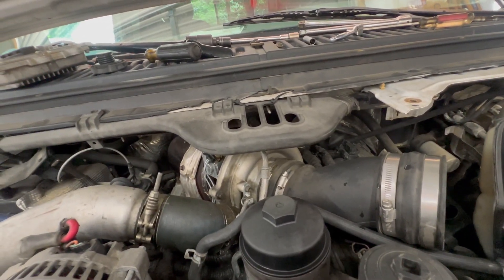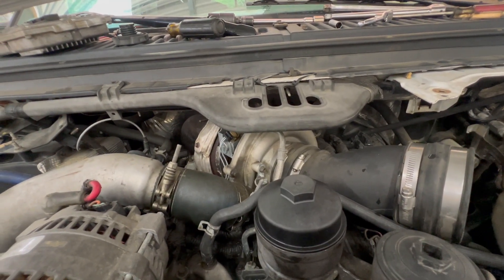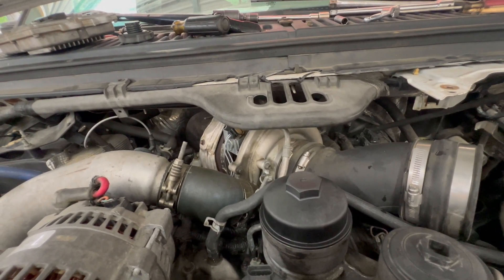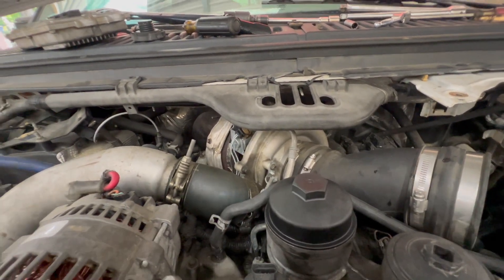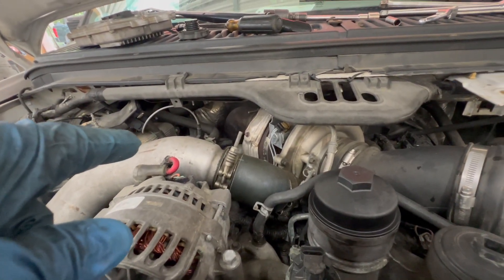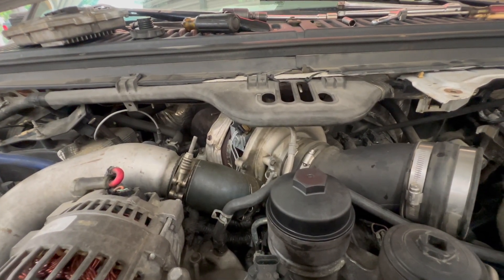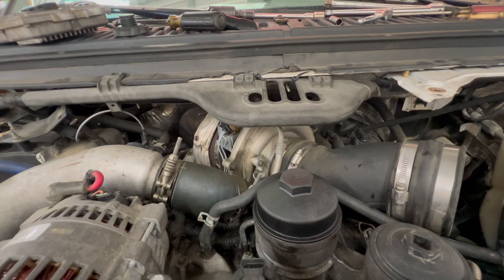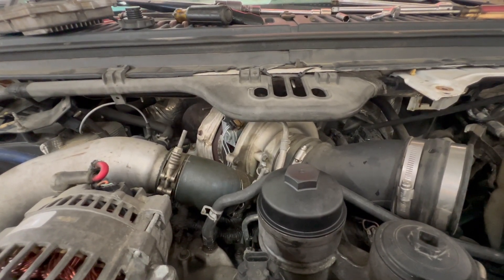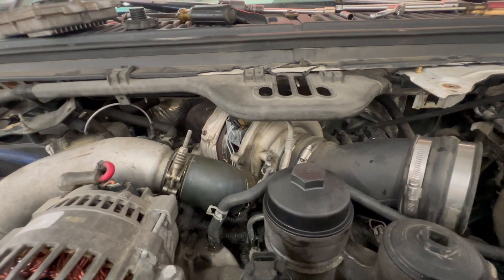What I'm going to do before I bust anything down is put a new Motorcraft IPR on it, run it, do the same thing, and see if we still have a crank no start hot. I really think we're not going to. There's no sense in wasting money busting it apart if that's not the problem. Worst case, we pull it out and put the factory one back in and don't charge him for an IPR. The IPR should be above 70 — they may not truly be at 70 even if it says so.